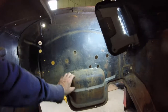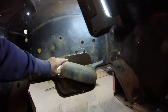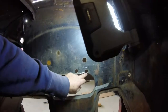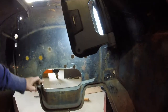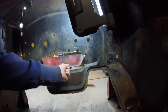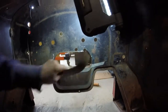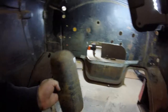I've had a bit of a play and I'm gonna have a beer — it always helps me think. I'll pick up on the video later when I sort something out. Okay guys — to give you a quick look at what I'm doing: I've just cut this out, as you can see — this is for the clearance. There we go. Now that heater control should fit; it's just a shame it caught the bottom of this, but it won't matter. If I weld in a flat piece here that'll give me the clearance, and I'll weld a flat piece in across the bottom here.